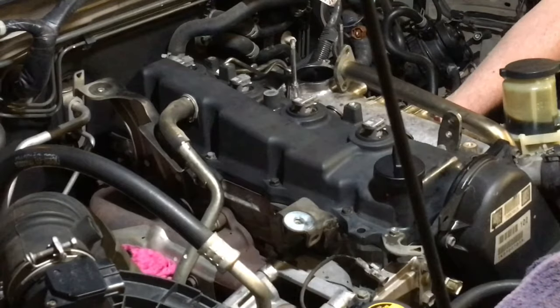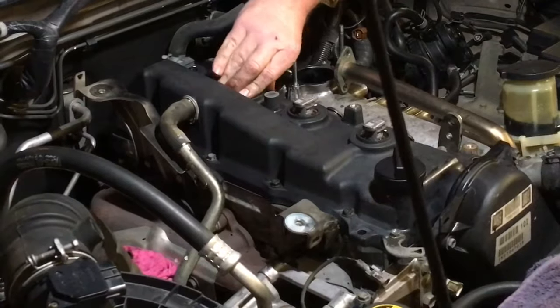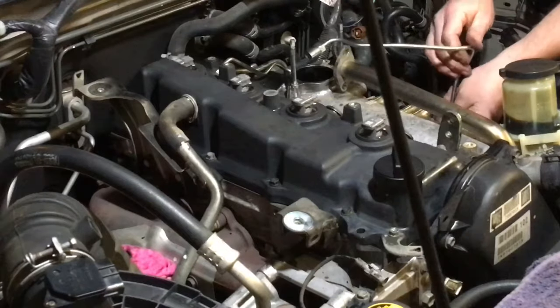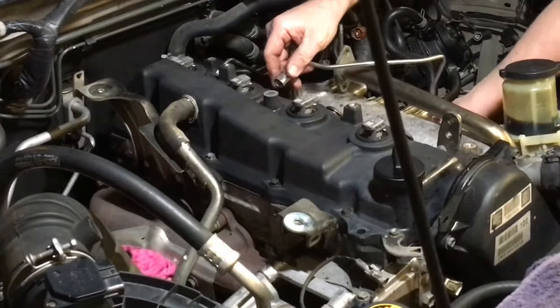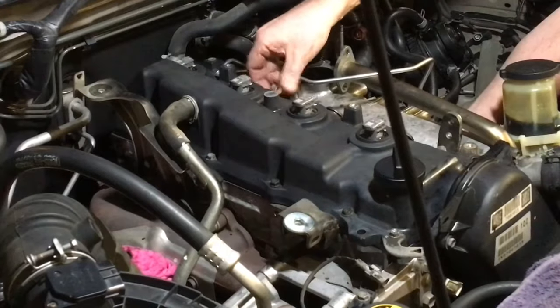I noted that we couldn't get to number two without removing number one. So what I do on the later ones is I put on 4, 3, 2, then I torque that up, if you follow me. Make sure they're pushed in all the way. Make sure you haven't got a catch can that's blocked up, because it pops them back out, and that has happened to people. That's real, so good luck to you in your catch can stories.